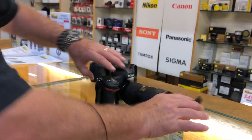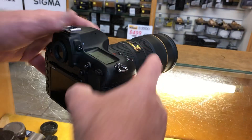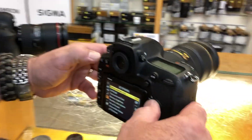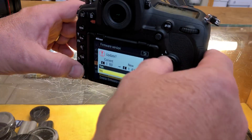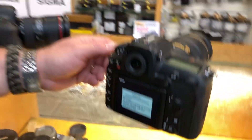Come back to the camera and put the memory card in. You need a full charge battery for this. I'm going to hit menu, firmware version, update firmware, hit OK, yes — and now it's going to update the firmware.